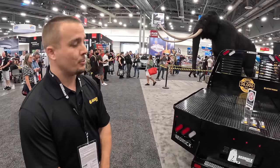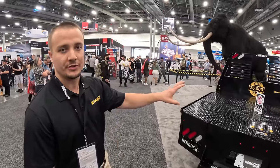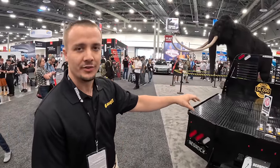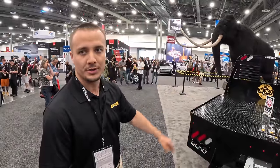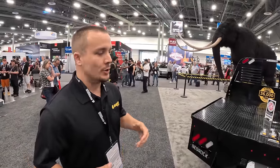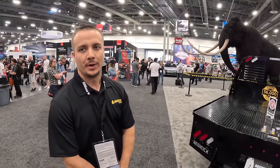All our beds are powder-coated, and our powder-coat process is really good. It's run through a shot-blast machine — shot-blasted to raw white steel. That shot-blast creates small indentions in the bed, which really allows the powder-coat to adhere properly. So if you're somewhere where you've got any rust concerns, that powder-coat and prep process is going to be a big deal in helping with that rust.